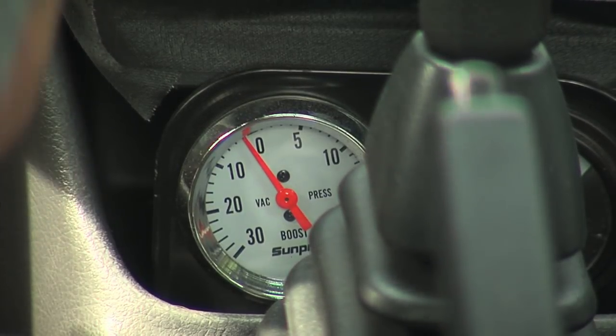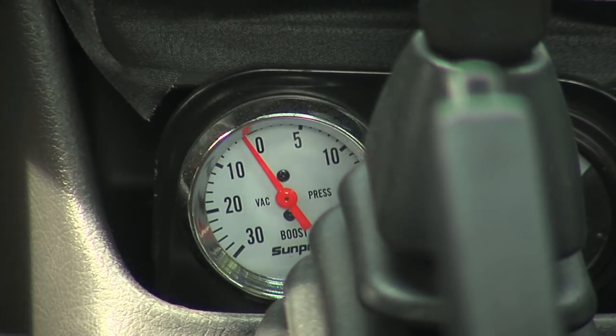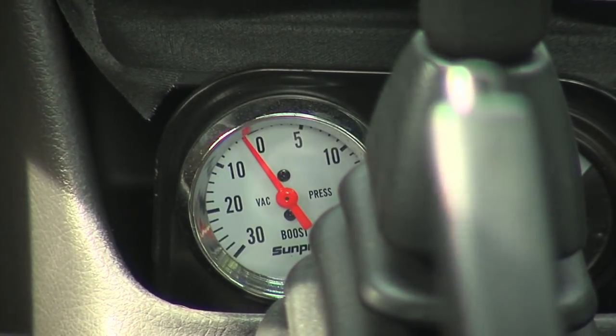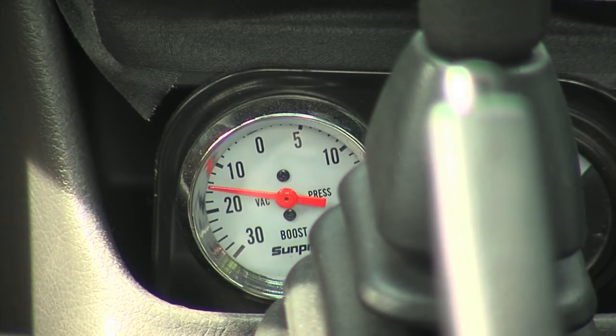Now I'm going to turn the car on. When I do, we apply power to the vacuum pump through the vacuum switch, and the pump runs until the switch tells it to turn off. We can see the vacuum is sucking and we see an increase in the vacuum reading. I actually have that switch turned up quite a bit — a little higher than it needs to be — but we've got plenty of vacuum. And you can see it stopped.